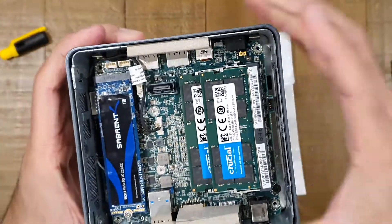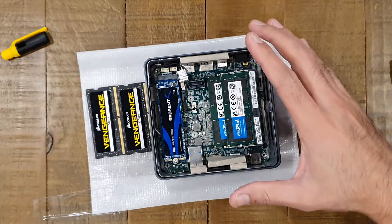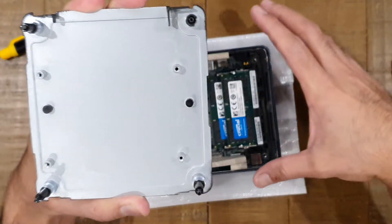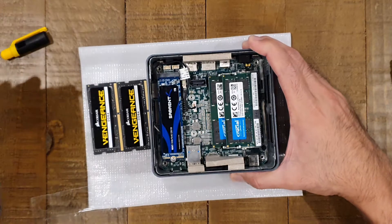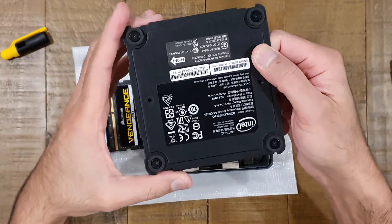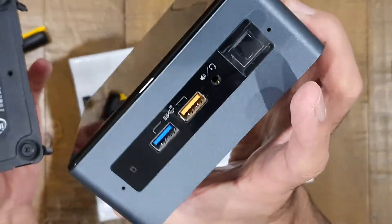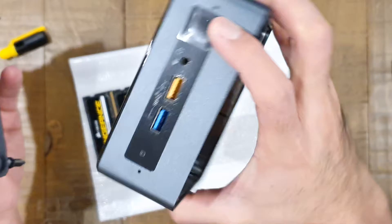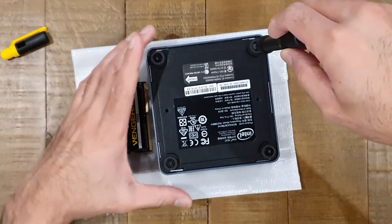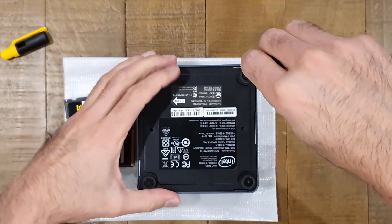You can see the SATA port here — I haven't got a SATA drive in this one at the moment and I've removed the SATA mounting bracket, so I won't be dropping a drive in there for now. Once you're done, make sure you line up the bottom plate in the correct direction — there's an arrow pointing to the front, which is where the front USB panels, power button, and headphone jack are. As long as you line that up correctly it'll drop back into place easily, then just tighten the screws back up.